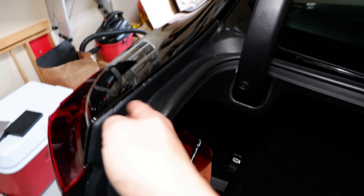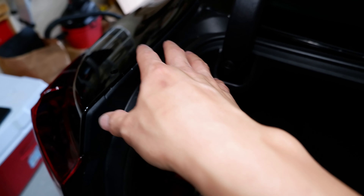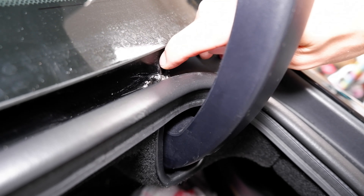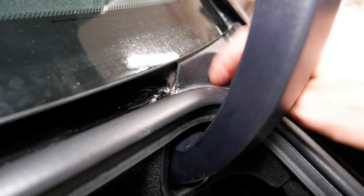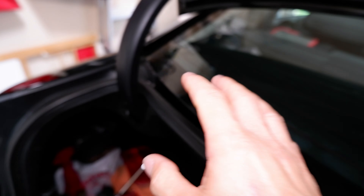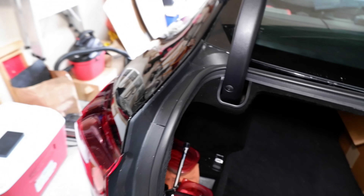While I'm in here I'm also going to go ahead and take these little side panels off right here. They're only held on by 3M tape. The reason I'm taking them off is that over the years — probably the 13 years I've been driving this car — stuff gets caked up in there: tree branches, leaves, dirt, all that crap. It's just filled up and it's not draining. So I end up with a bunch of crap here every time I wash the car. I'll peel that off, replace the 3M tape, and get it back to factory looking again so the water can drain through.